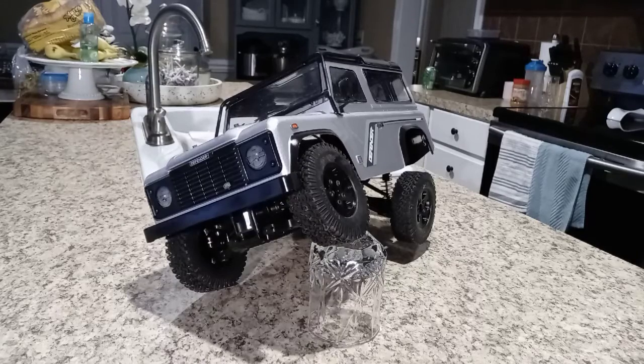There's still a lot of parts I need to get together. I'm having some trouble locating the right tubing to make all my suspension parts. It was originally just going to be rear suspension, but now with what I've done to the front end, I need to make a couple of front end parts to keep the geometry correct and to make the steering parts to get more steer and throw out of this truck. I may also have to take a couple of the loops out of the springs as well — I'm not sure yet.